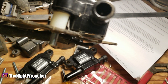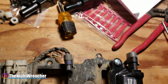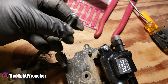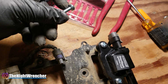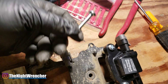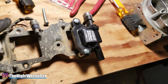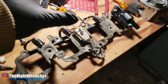The coil is not touching the bracket whatsoever. The hardware I ended up using is metric M6 by 1.0 thread pitch, and I used Phillips head bolts because they were cheaper. I could have used hex bolts but then I'd need a washer and it'd be twice as much, or I could get flanged hex bolts — those look really nice but they're about a dollar a piece. I wasn't about to spend two dollars per coil — that's another $16 just in bolts — so we're keeping this budget.